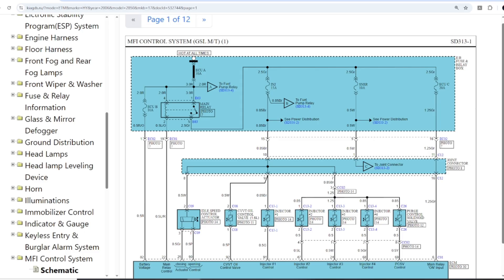If you truly understand how the ECU works, it will help you a lot in solving electrical problems. For example, when you face a car that has no power, understanding this logic will guide your troubleshooting steps. The ECU controls the whole system through the main relay, so the first step is to check if the main relay is closing. If not, check the power supplies going to it: the B-plus power, the ignition power IG, and the ground for the ECU. If all these supplies are correct but the main relay still does not close, check the control signal from the ECU to the relay. If the signal is present but the relay does not close, the problem is in the wiring or the relay itself. If there is no control signal, then we can conclude that the ECU is faulty.